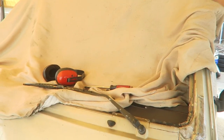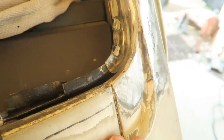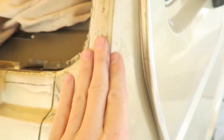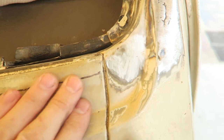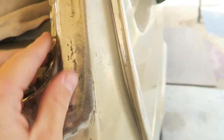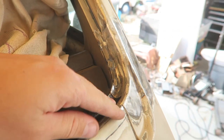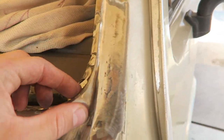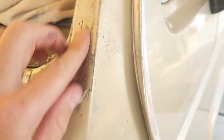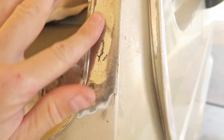I threw this welding curtain over the front so I don't burn down his bus. I went ahead and threw some weld around it and ground it down. I got a few little areas I need to fix with the welder, but it's once one piece of metal again. Of course I'm going to glaze this because there is a little bit of ripple in some places — the metal shrinks when you start welding on it and it gets hot. But the body lines came out super dialed. It's actually a really good fit. I've got to glaze this and fix this spot with the welder — get some more metal in there. But all the holes are filled.